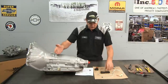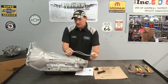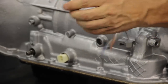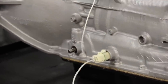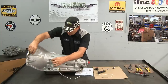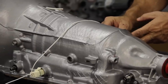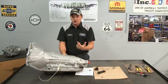Now that we have the wire running the 12 volt source down to the transmission, this will be the pigtail connector — it will only fit one way. It has a locking tab on top and a lock pin on the top of the factory case connector. With the connector facing upward, simply snap it in. Take your 12 volt from the toggle switch, wire it into the connector, and now you have your 12 volt source. The ground connector will feed over to the pressure switch on the other side of the case, which screws into a port already in the case to control your fourth gear.